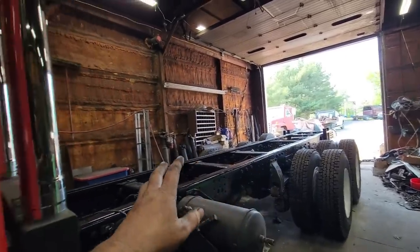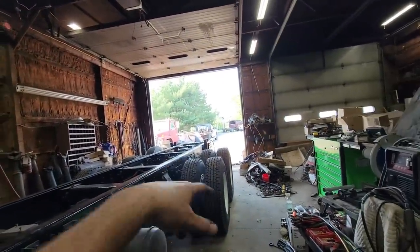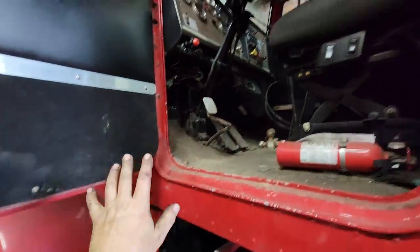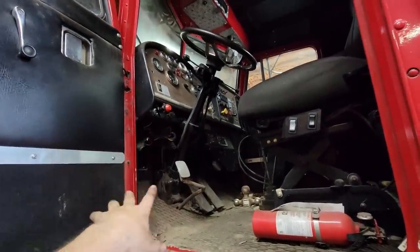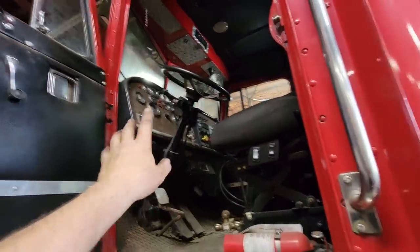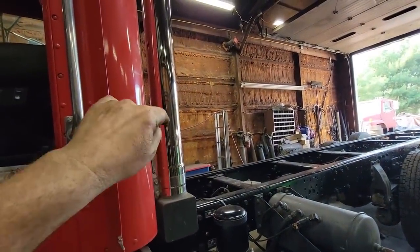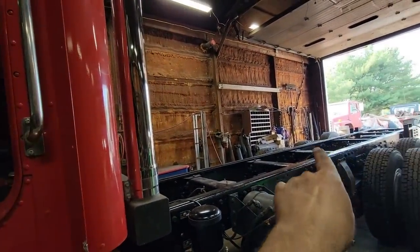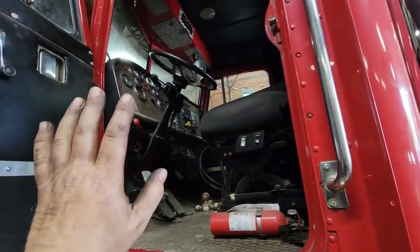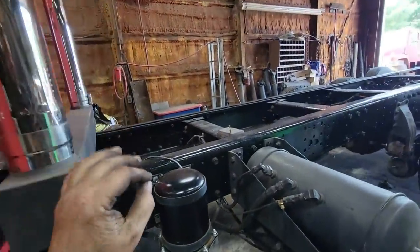And the backup lights worked fine until you turned on something else, and then it didn't work. And I figured, screw it. I came up here and I pulled out all the old add-on wiring and all the stuff under the dash where they've done workarounds, where something didn't work, and instead of trying to find the problem, they just took a wire and put it from here to here and went around it. So I took all that crap out. I've repaired everything, soldered in everything, and ran wires to make them correct like it should be.